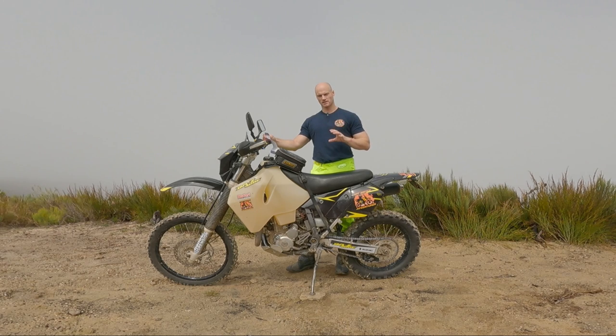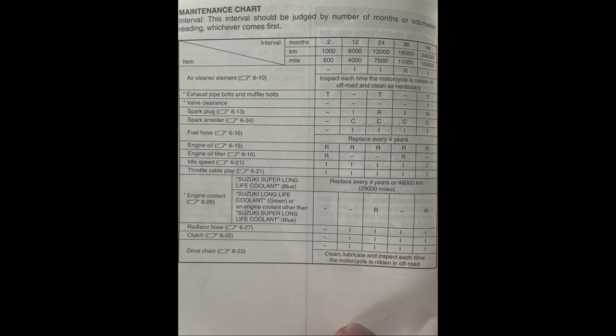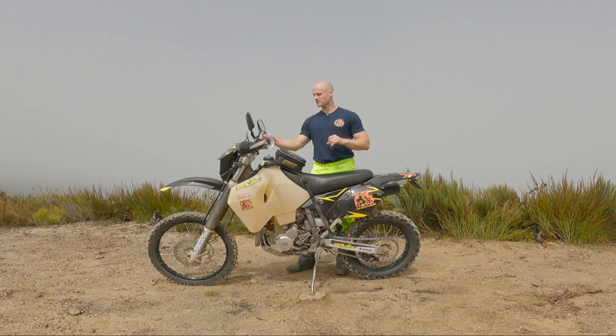Pro number five: service interval changes, in relation to the bike being able to do a bit of everything. Straight from the owner's manual: your first oil change is at 1,000 kilometers, then every 6,000 kilometers if you're not thrashing the bike. I can back this up — I've done multiple 5,000-kilometer trips and never changed the oil during the trip. The oil filter after the first change is at 18,000 kilometers — I'd never leave it that long, but that's what the manual calls for. And the first valve clearance check is at the 24,000-kilometer mark.